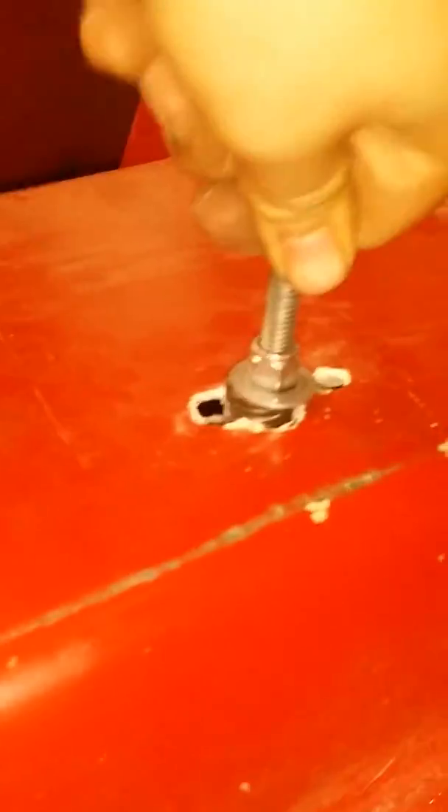I have a little brace there to keep it from breaking the welds, like it's done about 50 times. I have your standard go-kart TAV-2 clutch on here, belt-driven, goes down to chain drive. I have some custom pulleys I made back here — an idler, a tensioner that's on all-thread, coming up here, which is spring-loaded and adjustable so you can adjust how tight your chain is. Right now I have a little bit of slack in it, just not much. You don't want it to come off the sprockets when you're doing 16 — it gets pretty ugly.